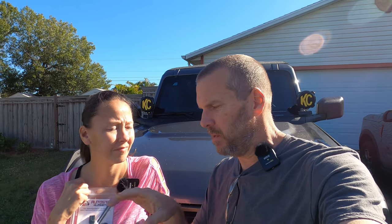What this will do is give you the option to either have it on or off. Whatever setting you push — whether it be on or off — is what it stays until you decide to change it. You don't have to take it all apart again. You don't have to reprogram your computer. You don't have to unplug something underneath the hood like a lot of people have suggested. Anytime you have an open contact underneath the hood where you can get mud or water in there, it creates an electrical problem — possibly a short later on — and that's all on you.